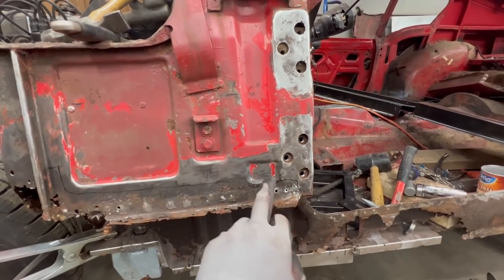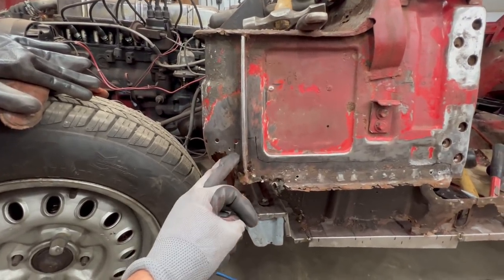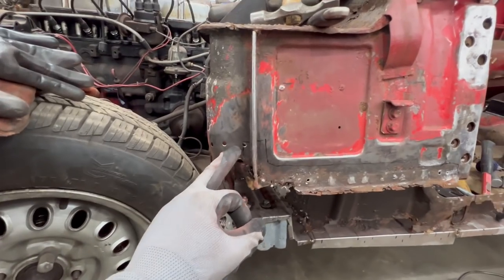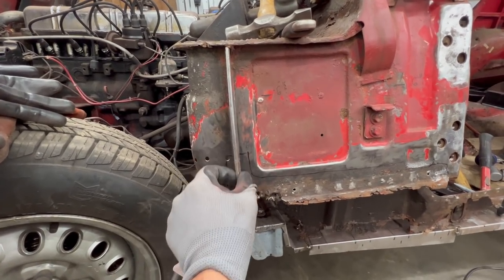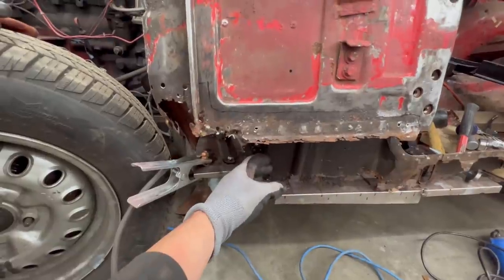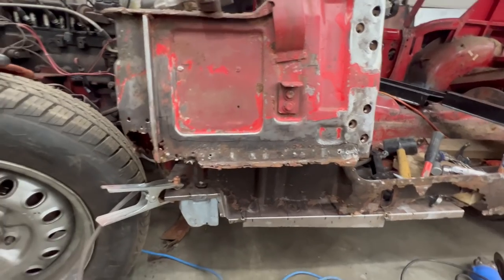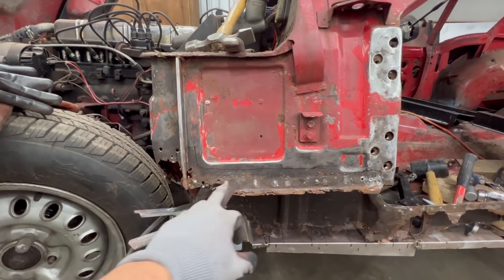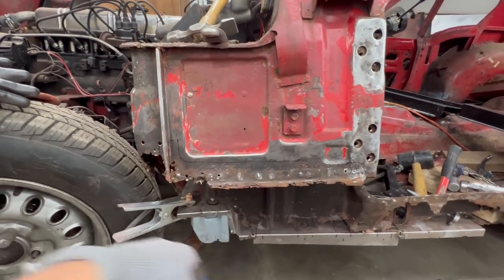If it is too thin, we might go higher and make this shape, but I'll try to avoid it. Here, I'm going to cut also part of this on this side because here it is rotten. I'm going to replace for now just this vertical line here, just so I can finish this flange nicely. But I'm thinking that when I cut this out, maybe it's a good idea to repair this panel first, which is pretty bad. Like here, I don't want to make a plan, because things are going to happen as they come. So let me cut this out and then we're going to assess a little bit better this underneath and see what we're going to do there first.